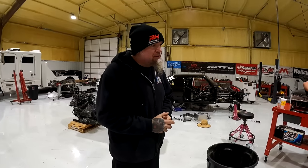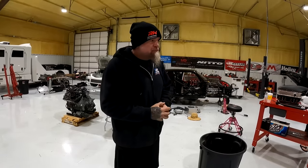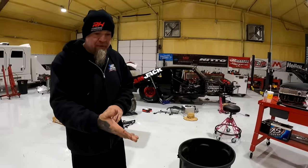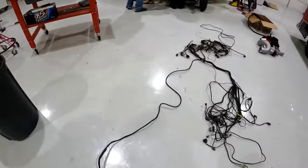I was kind of getting excited to start making some hoses today, and then it was literally the easiest fuel system I've ever made. 10 feed, 10 return, yep. Like 8 crimps, and it was done. Yeah. All the same size, didn't have to change the machine at all. Makes it nice. Yeah.